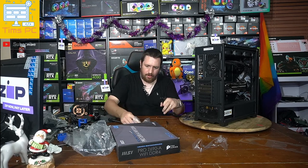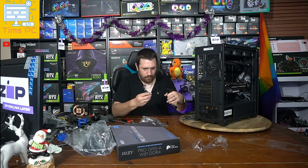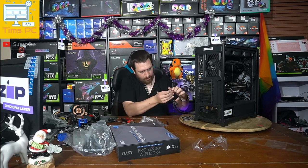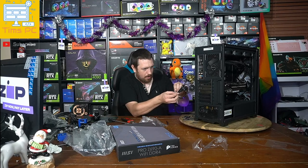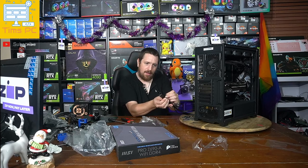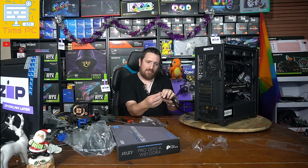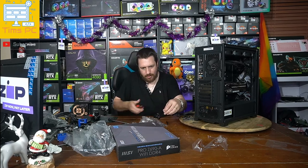Okay, so the trick to wiring these cables up with these clunky 12-pin adapters is to line your 8-pin cables up like this. Get them all facing the right way, and then just tie it off and flatten out the cable there. That's step one.